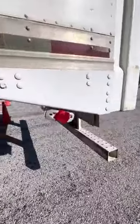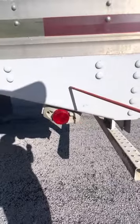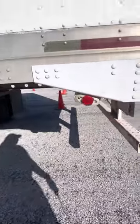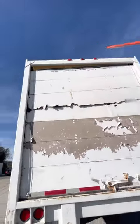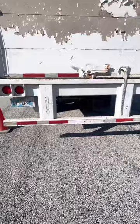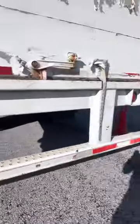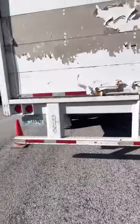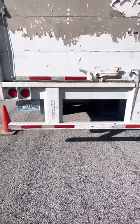Okay, here. Normally, I have my ABS light. It'll be properly mounted, secure, not cracked, bent, or broken, amber in color, and working properly. My clearance slash marker light. At the top, my clearance slash marker light. Left and right turn signal, four-way flashers. Nighttime running light, your brake lights inside. All properly mounted, secure, not cracked, bent, or broken. They're red in color, and they're working properly.